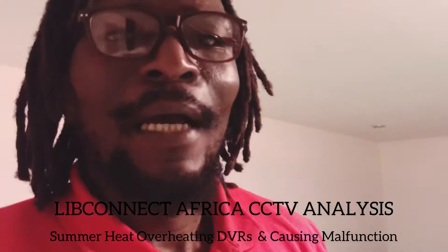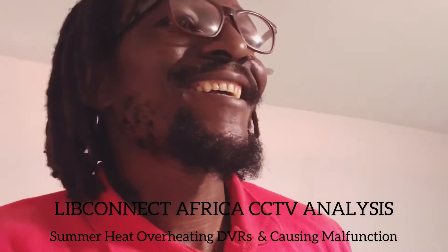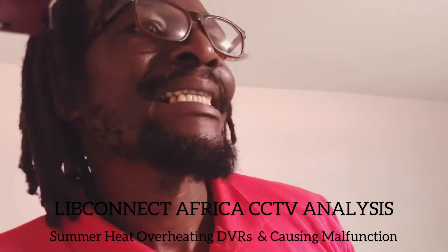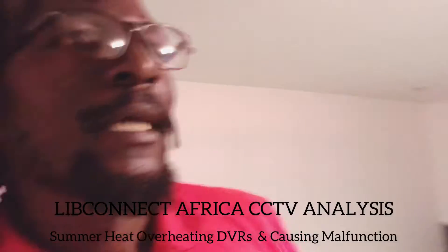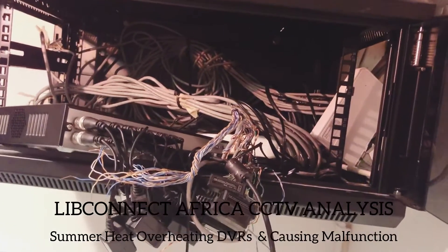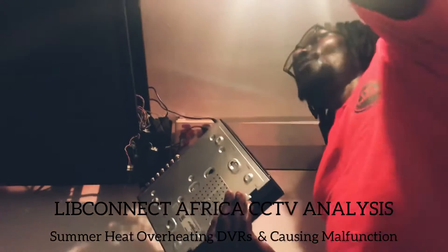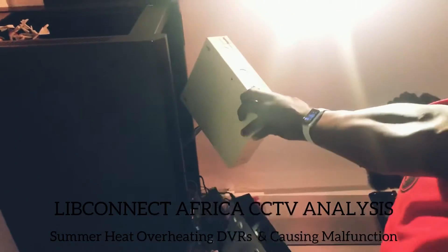I'm back here to finish up after changing the DVR this morning. I've got a problem with the power supply and I'm asking myself why do I keep having these problems. Since the renovations were made we are now in a hot box, and also with the cameras the way they were installed it was such a bad job. With the box, everything is getting hot so the DVR gets hot. The current issue why things are not working is because of this power supply here.